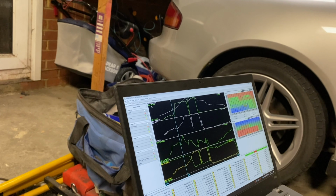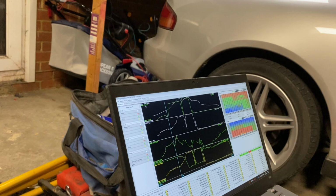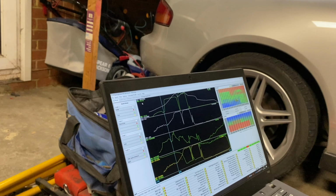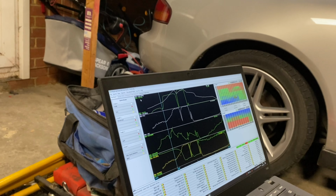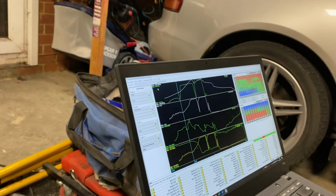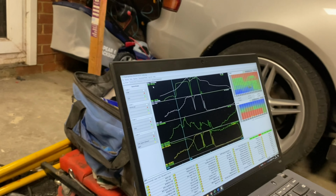This is the other thing, the throttle position only ever got to 93.2%, so you might need to recalibrate. Might need to have a little mess. I don't think it needs to be calibrated. I think the linkage is probably a little bit loose, maybe. I've got that spare one at home. So I think we need to have a look at that.